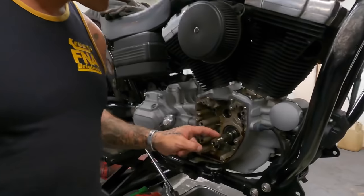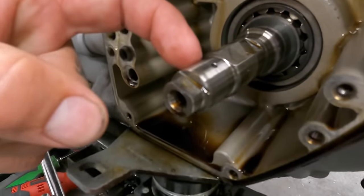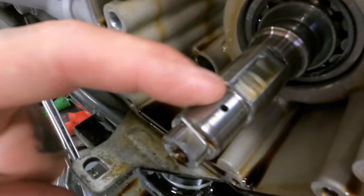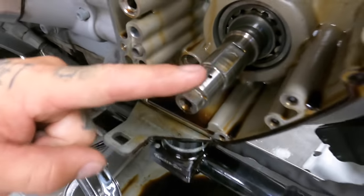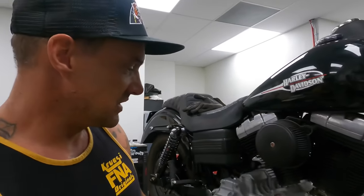Crank looks really good. You also want to check the pinion shaft for scarring — see the lines? They're always going to have lines because it's just running on a bushing, but run your fingernail across it and if it feels smooth as glass, like this one does, it's in really good shape Jake. Besides the cams — they were smoked. And I bet if we pull that oil pump off, it's smoked as well. But the crank is in good shape — the shit that matters is in good shape. I'm going to start putting the cam plate together.